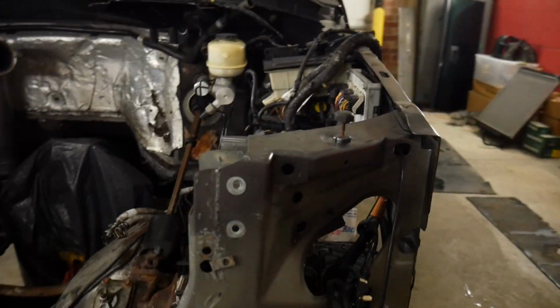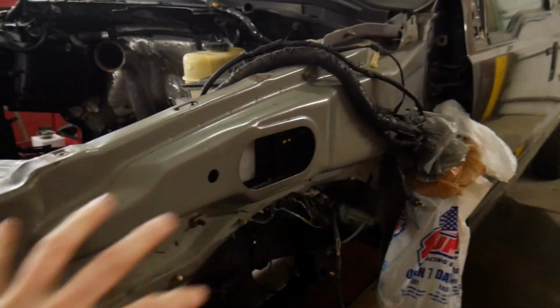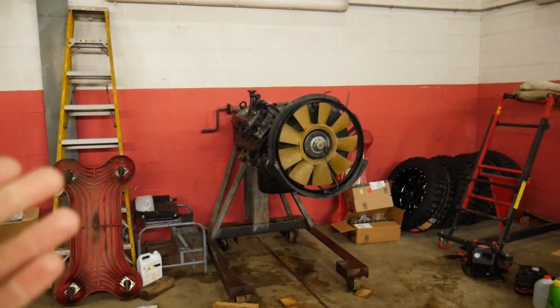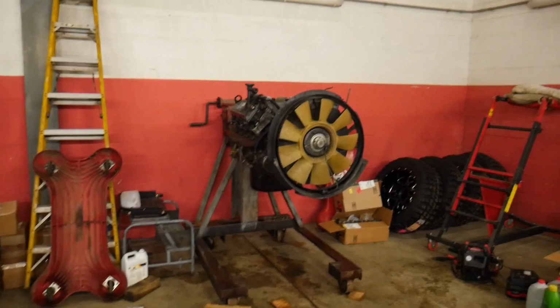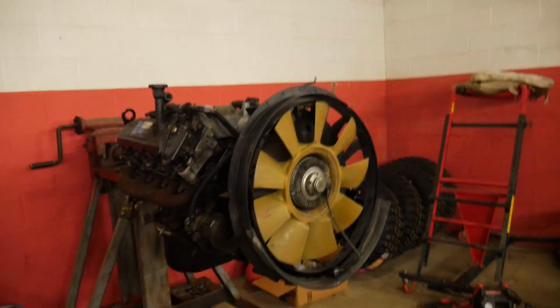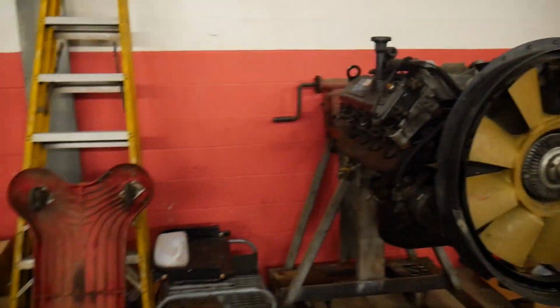We're gonna dust in all of the core support and whatnot, all that body color, paint all that real nice, and then hopefully get that motor tore apart, get the front cover resealed, get the rear main resealed, seal up all the oil pan and all that down there, bed plate, whatnot, and hopefully have the heads off and ready to go. Lots to get done this weekend.